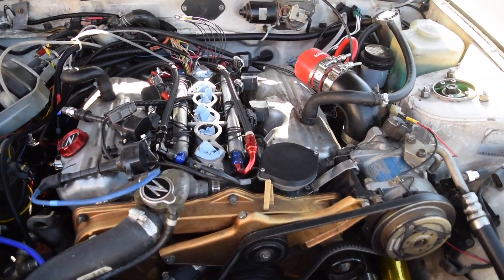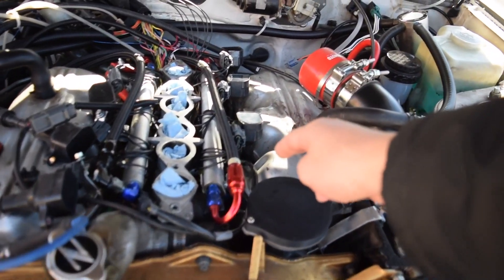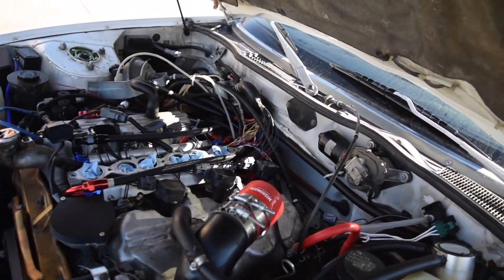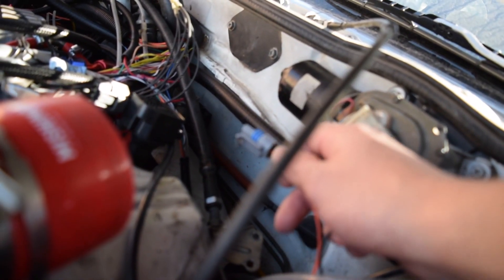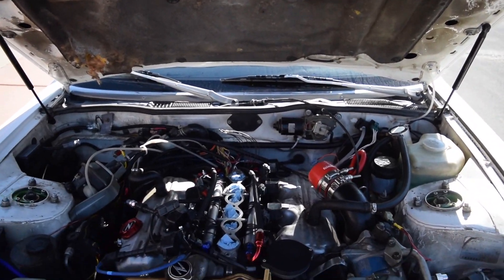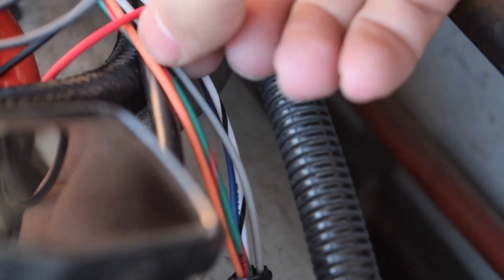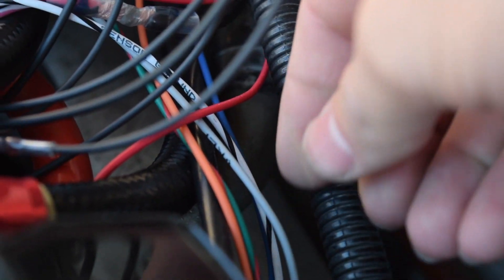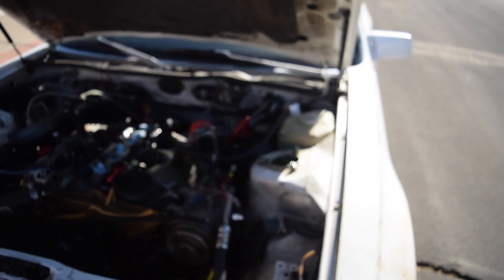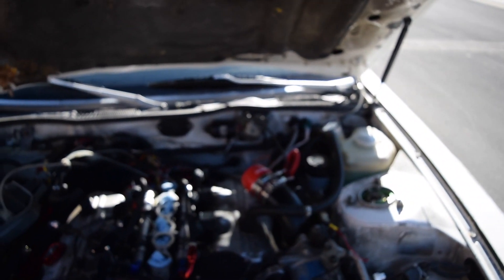Now let's talk about the rest of the sensors. We have the crank angle sensor, the CHTS — mine's in the upper intake. We have our TPS (throttle position sensor), the MAP sensor, and then the intake air temperature sensor. All of these need a 5 volt power. Coming out of the ECU harness there is a gray wire labeled VREF — V-R-E-F. This is a 5 volt reference voltage, and it is needed for the MAP, the intake air temperature sensor, and the crank angle sensor. All three need that 5 volt, so you'll have to split it up — just splice in some wires.